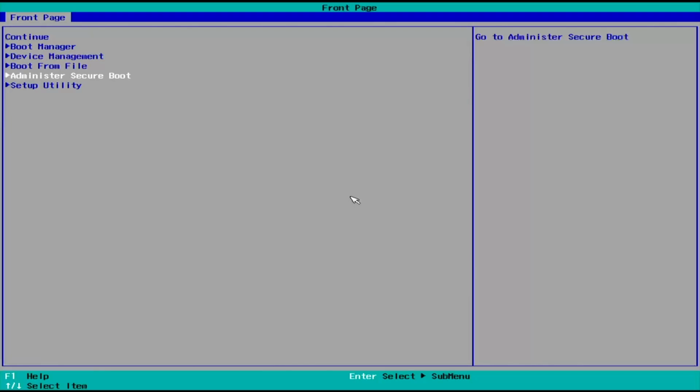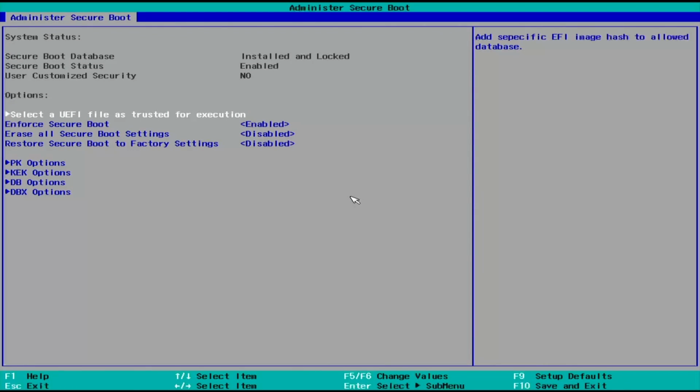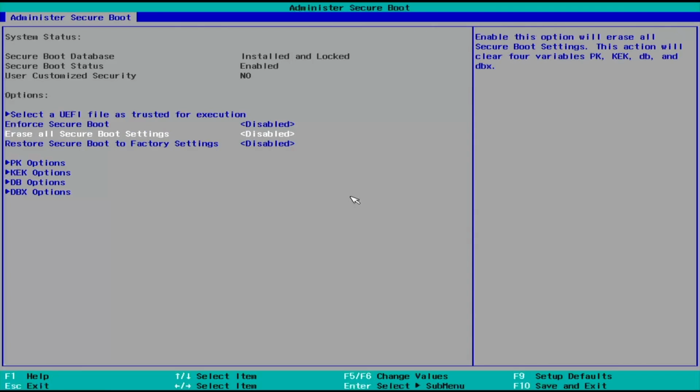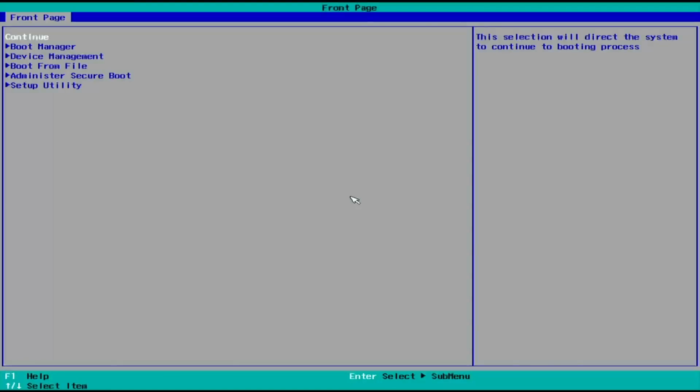First of all, we need to go to Administer Secure Boot, and then type the password in. I'll share the password in the description. And once you're in here, you just hit enter on Enforce Secure Boot and set it to disabled. And that's pretty much it. Now you need to press F10, exit saving changes, hit enter, and again keep pressing escape. So now we've disabled secure boot, so we can boot Batocera, for example, or any other OS. Just keep pressing enter. There you go, we are back in.